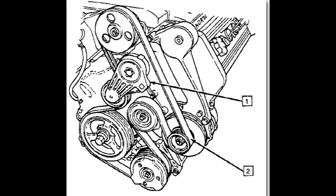Once you've got the serpentine belt off the power steering pump, everything should be pretty much loose and you can start removing the belt off the pulleys. They should all be coming off toward you, as the blue arrow shows. The only problem will be the one at the tensioner bar — the red arrow — that one you'll have to fish behind the pulley and pull it out from behind.